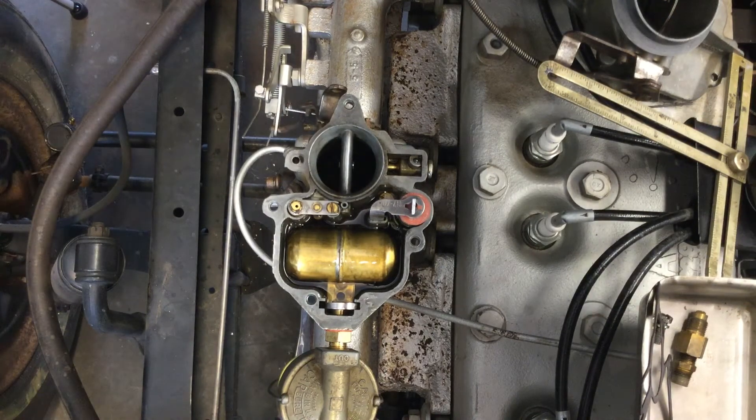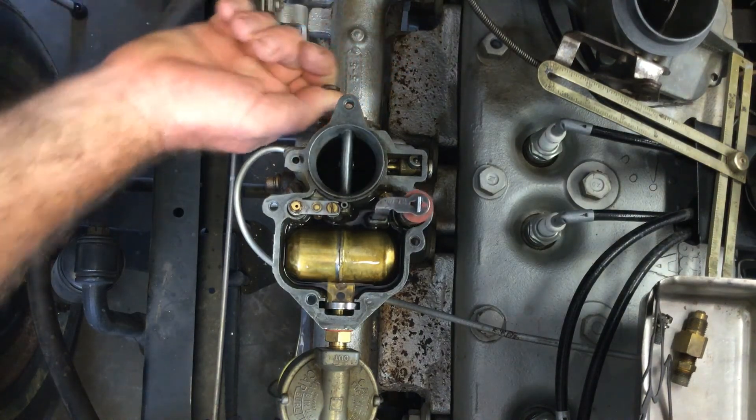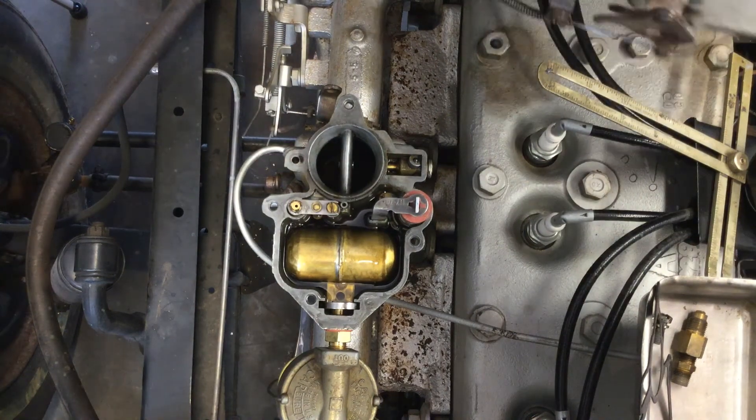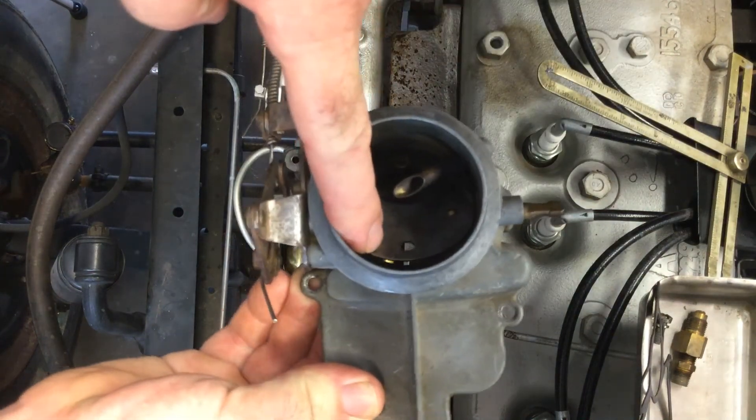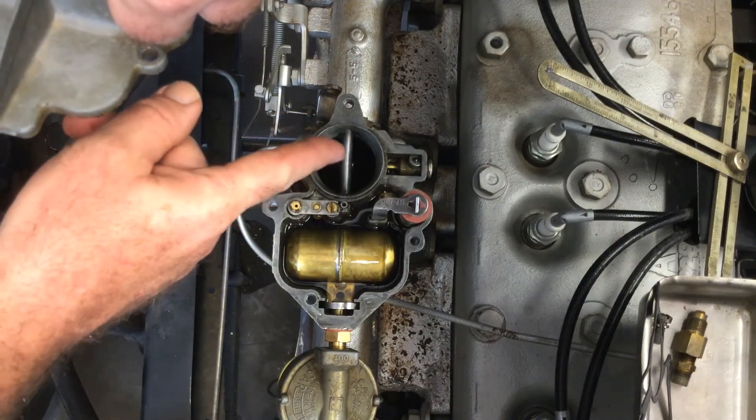On any carbureted car — I don't really teach carburetors to my students but I do talk about them a little bit in my fuels class. We discuss run-on, which we don't have to worry about with fuel injection, and vapor lock, which is related to fuel quality and also not a concern with fuel injection but is with carburetors. A lot of students may want to own a Dodge truck after they graduate, so it's good to have background on basic carburetor operation. You pump the pedal a couple times to get some fuel in, and when the engine is cold you want to choke it.